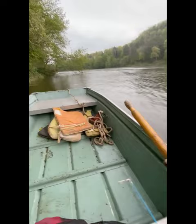Got here an array of different propellers. This is a regular 7-inch. This is a 6.5 high power. Let me see, 6.5. That one would be good for a stock engine, bigger boat, keep the RPMs up. The high power was a little bit more aggressive than the 6.5. That wasn't bad either. Honestly, the 7-inch thinner one was the best so far. And then I got this number one high speed prop, which is a little aggressive for a stock motor.